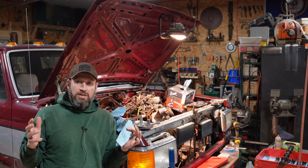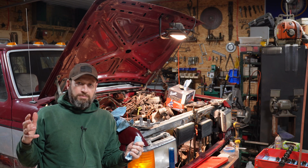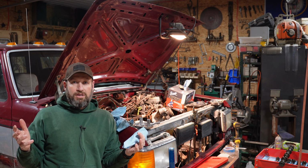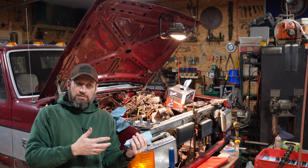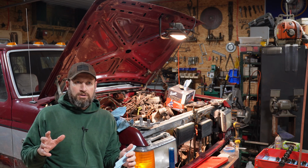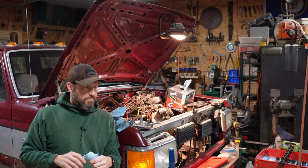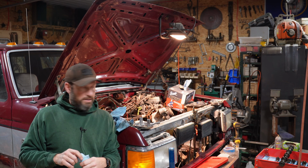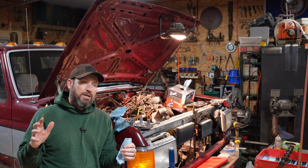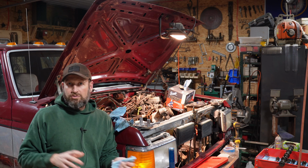All right, well, that's gonna be it for this video. There's not much else I can do at this point. It's a Friday night. I'm gonna be taking some of these parts to my local engine guy. If I do have to pull the engine, I'm only a transmission, the flex plate to the torque converter, and a couple exhaust manifolds away. It really wouldn't be that big of a deal. I'd probably get the hood off and out of the way. Maybe. I don't even know if I'd have to do that. It would make it easier. Anyway, when I get to the point of figuring out how I'm going to proceed from here, I'll just go ahead and make another video.